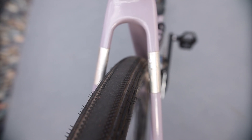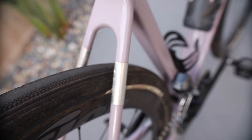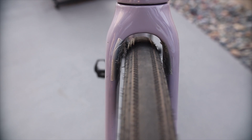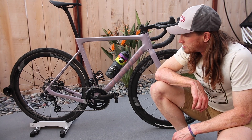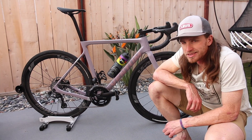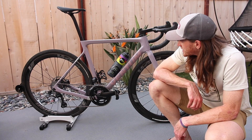I've got some aluminum foil tape inside the front fork, wrapped around the chainstay and the seatstay. The purpose of that is to protect the frame from any rubbing if mud gets built up in the tires. We put that on before the Mid-South race because it was looking like it was going to be muddy. Fortunately I didn't need it, but with a bike this beautiful you've got to protect it.